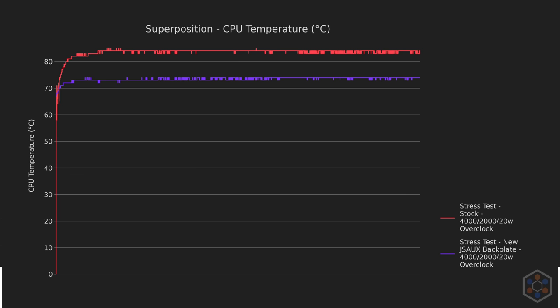The noise generated with the new backplate was a lot lower — 6.2 times quieter with the overclock present. However, with the fan uncovered, the more grating frequency of the delta fan becomes much more apparent, so this is definitely a balancing act that depends on your specific deck fan model.